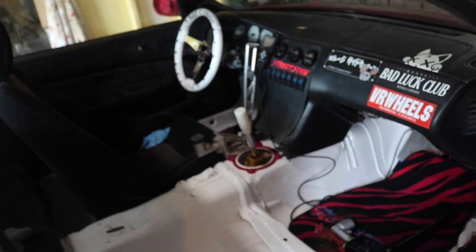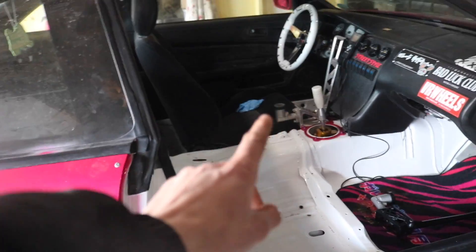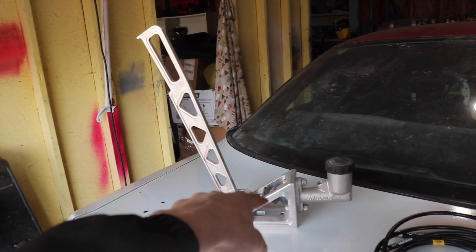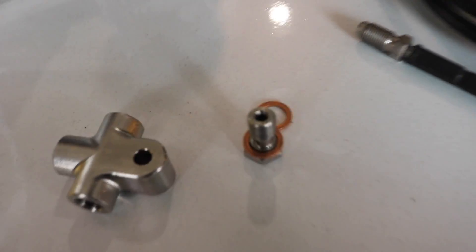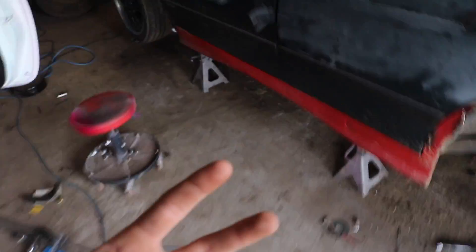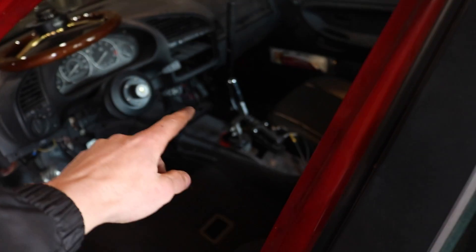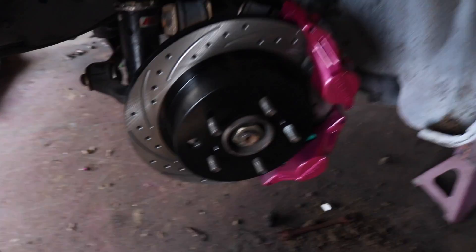We're basically going to be getting the Hydro E-brake in today. I explained in the last video that everything was just going wrong, and yeah it sucked. So we're going to run these lines today and show you what they are. This is going to be the ultimate Hydro E-brake install guide. Step number one: you need a Hydro E-brake of some sort. Step two: you need lines with all types of fittings, T's, banjo bolts, and copper fittings. Or option number two — the inline setup — where you tap into the rear brake line from your master to the rear wheels and put your Hydro E-brake in between. But today I'm going to explain the dual caliper setup.